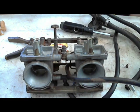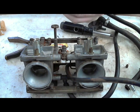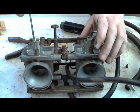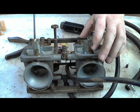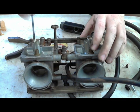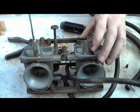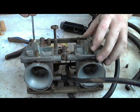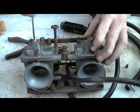The idle jet. Main jet was fine. The needle jet. So this is clean. Put it in, and then you don't want to over tighten this, but you do want to get it a little bit snug. So once it bottoms out, yeah, the screwdriver keeps slipping off the head. Okay, so once it hits the bottom,